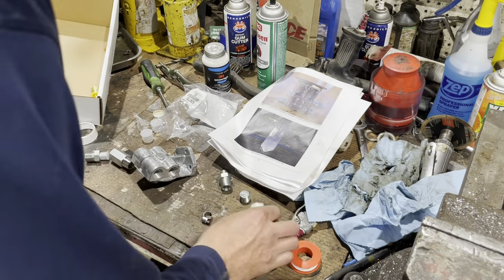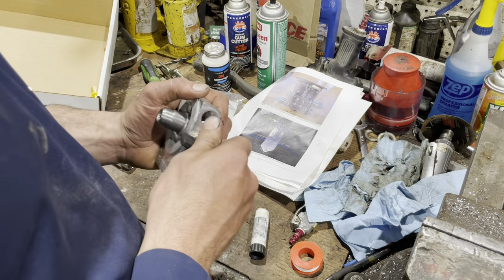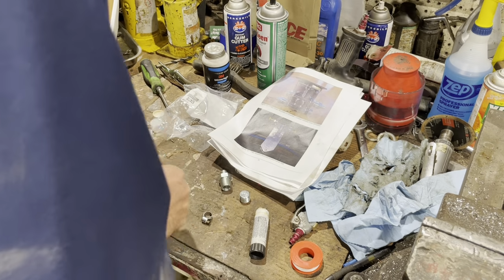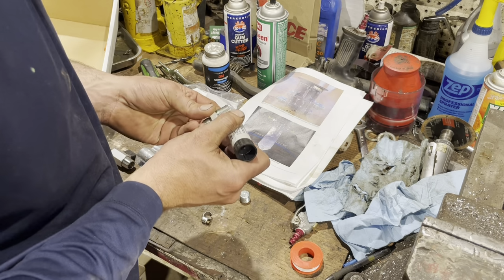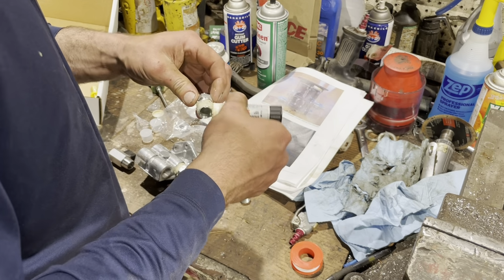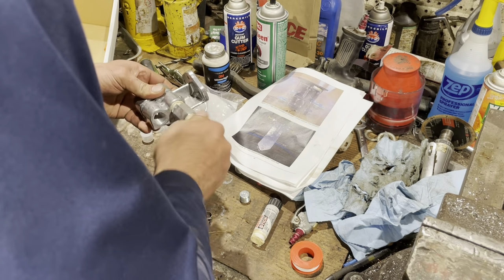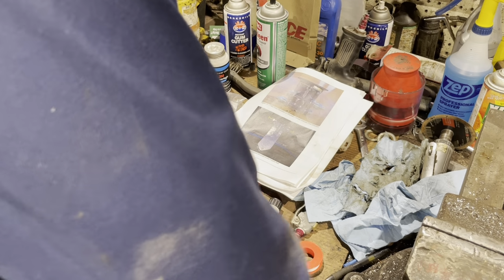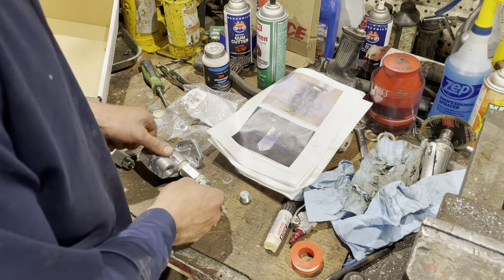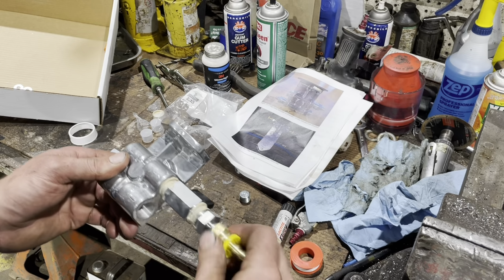So we're going to do that one. We're going to put that in first. This is the only plausible place in the kit it can go. So that one's going to go there. Then we're going to get our JIC fitting, the 3/4 pipe to JIC fitting, next, and it's going to go there. And then we don't need this on the JIC because that's like a compression style there. So we're just going to throw that on there like so.